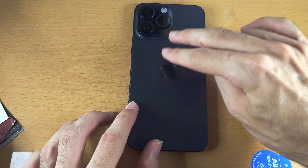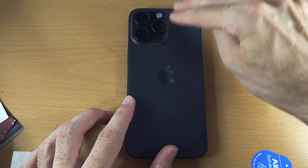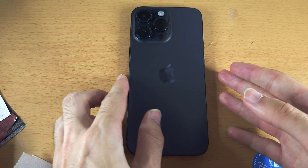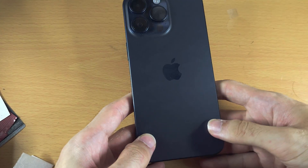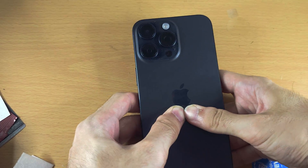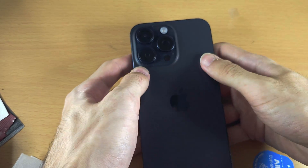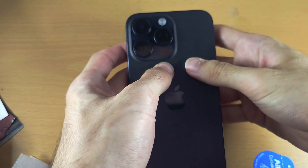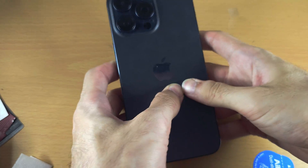Use two fingers and tap really hard all around the iPhone — go all the way through and tap as hard as you can. You're not going to damage the phone. Tap around the camera area as well. Then get two thumbs and with maximum force push them together — you may feel a click, which means a connector has gone in. Go all the way around the iPhone adding lots of force so any unplugged connectors get pushed back in.